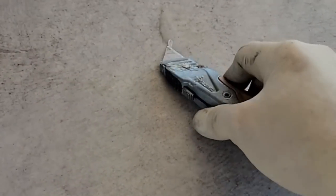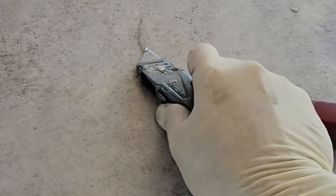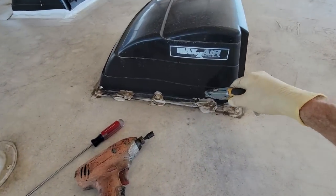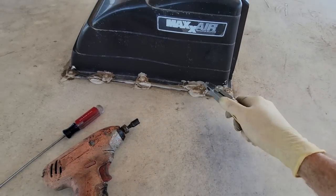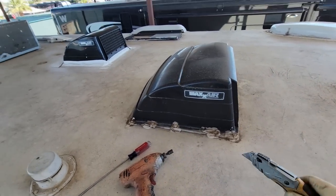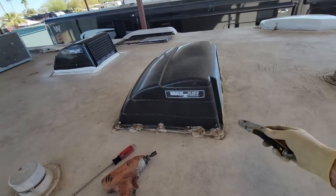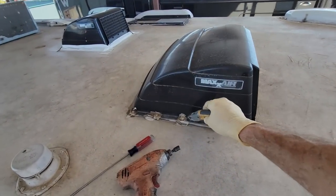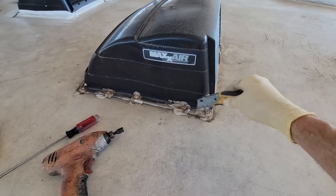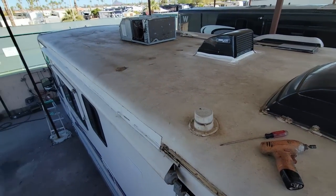Somebody did this after the fact because people always assume that a roof coating is going to solve all their water problems and make one continuous monolithic membrane. But it doesn't. When we take the ACs off we'll see they did the hack repair too — they didn't take the ACs off to do the coating, they just kind of coated around it. So again it's not even a monolithic coating, not that it was going to do anything anyway. Do not screw these vent covers down into the roof ever. Use the bracket they come with because all you've done is trap water inside there. This is not watertight — water can get in here very easily, get down in there, and just sit because it can't get out.